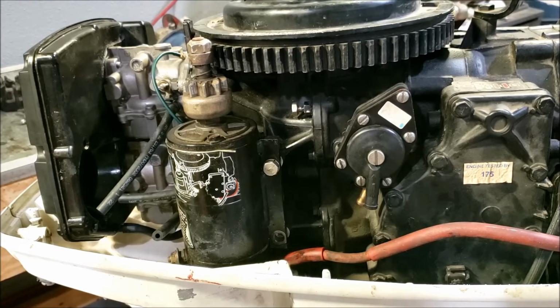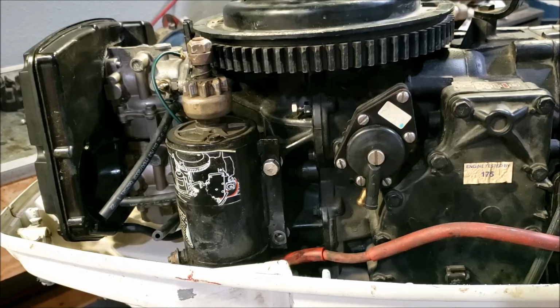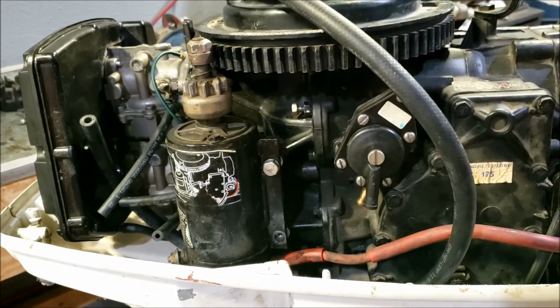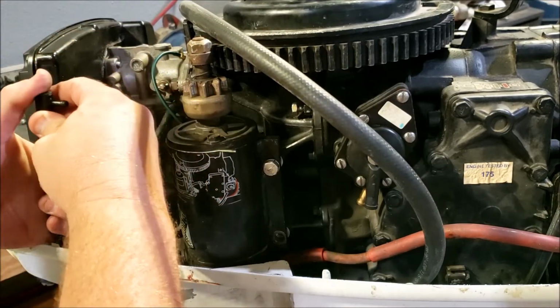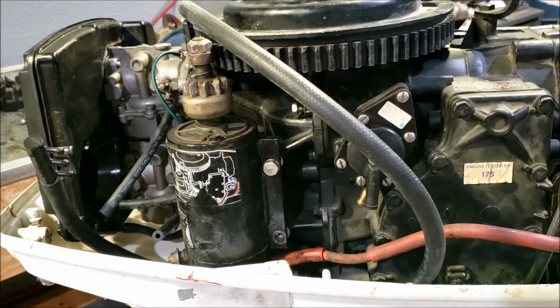Now in 1989, they no longer had those fittings. You now had the fuel manifold just flipped and then used. So that is the method we are going to be doing here. I have a 3/8, I believe, 5/16, I mean, fuel line. I'm going to route it under the lower mount of the hood pan and then come up over there. Install the fuel fitting so that the bends of the hose kind of follow it naturally. And install a hose clamp. Four of these. Oops.